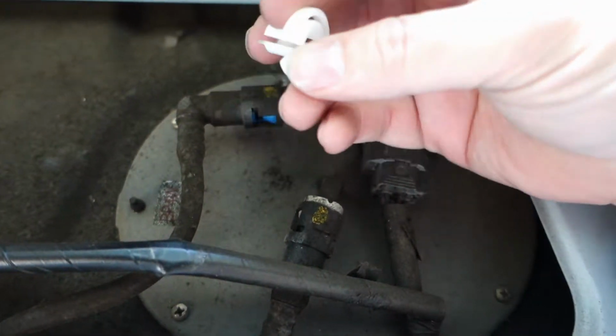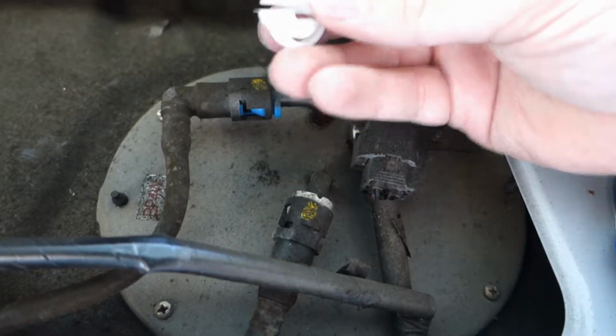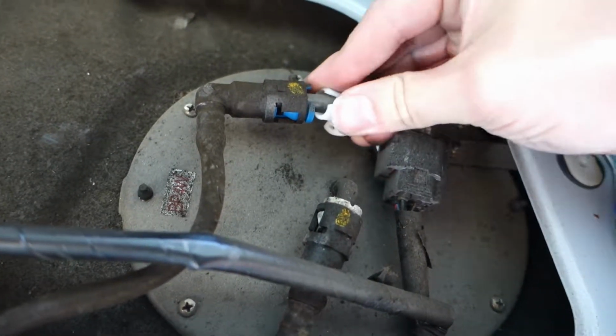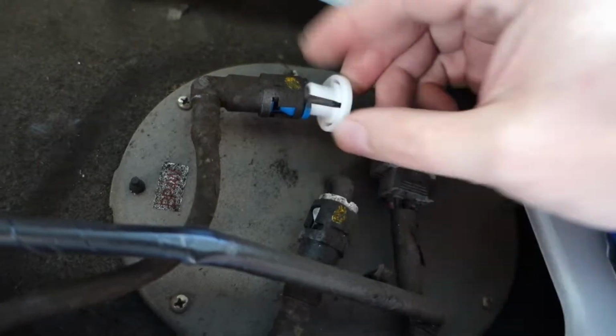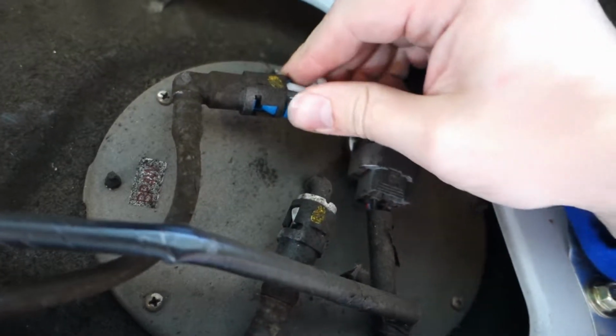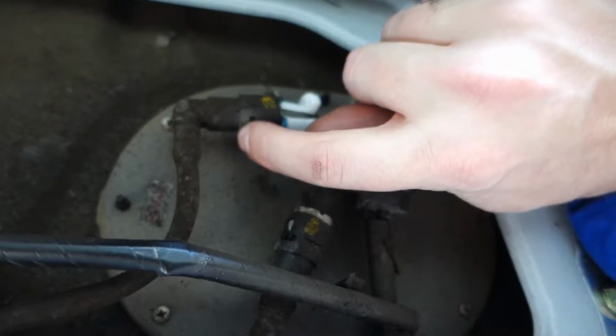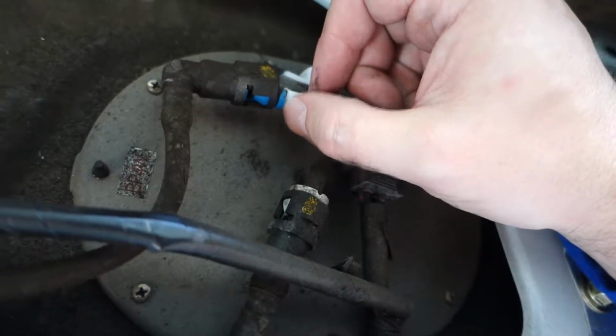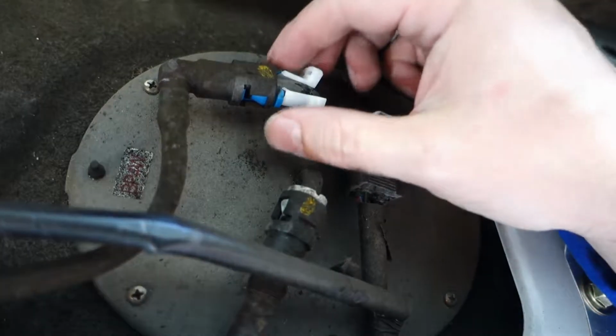All right, next up, the manual says we got to take out the actual connectors from the fuel pump, so I'm going to do that. The connectors are right here, and helpfully with the big fuel kit, they give you this disconnect kit or tool. What this does is you slip this over the fuel line, and it looks like that. And then this pushes, if I can align it right, these fuel connections have little tabs. So there's a tab right here and another one on the opposite side. What you want to do is make this tool push in so that these plastic pieces push these tabs outward, and that'll allow this connector to come off.